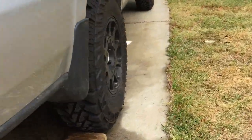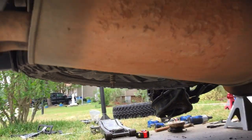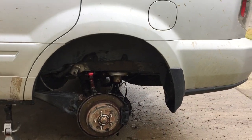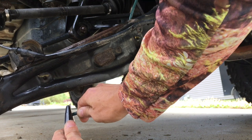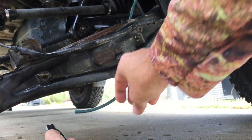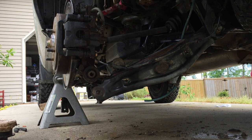The other air spring on the other side routes up behind the spare tire and then kind of pairs with the other air hose, coming in the same spot — so it's pretty easy. The kit came with enough air hose to make that run. I'm going to use a razor blade to make a really clean cut here. That was actually a really good clean cut. Now when we get the air spring back in there, I can press it up and try to get a really good connection on that macro fitting.